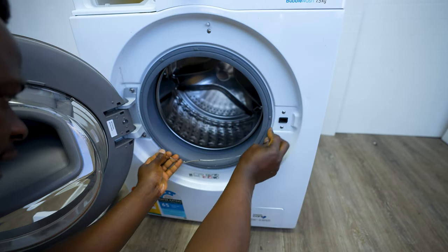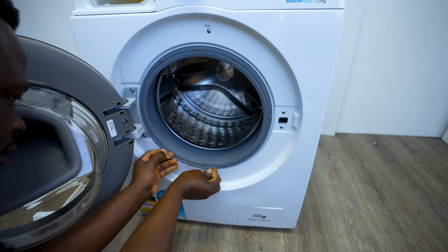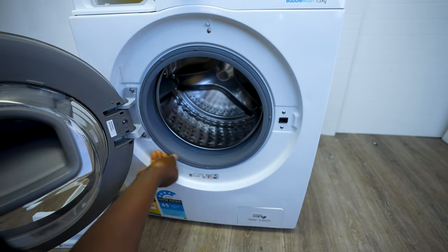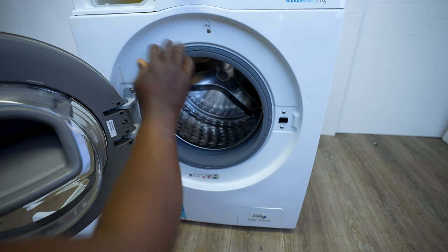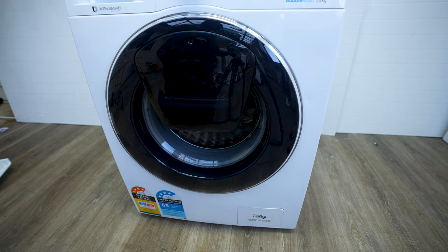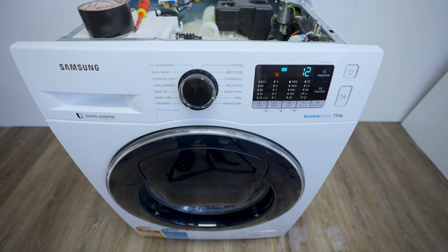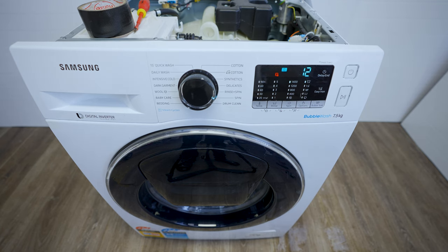This ring goes in last. Make sure it's nicely in there with no chance of it coming out. Make sure your wiring is secure. You can get a replacement door switch from Samsung or on eBay — just quote your model number and ask for a door switch. But first check all your wiring as we did. Putting everything back is just in reverse. Make sure you secure your cables, and safety first. Thanks for tuning in — I'll see you on the next one, bye.